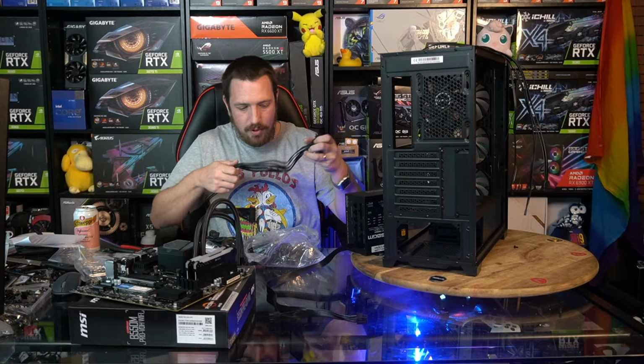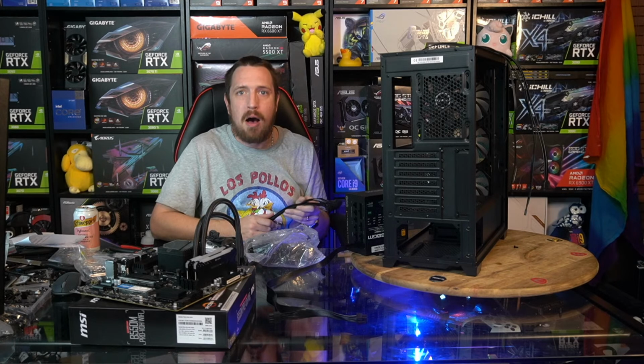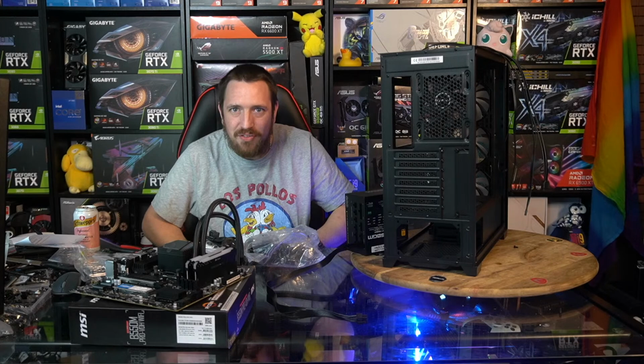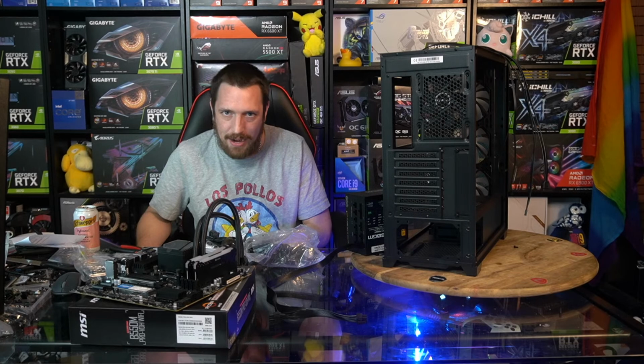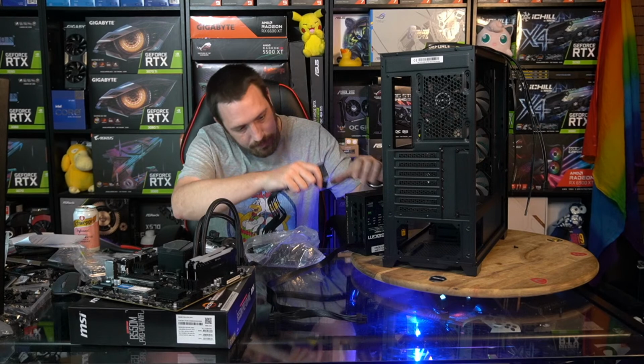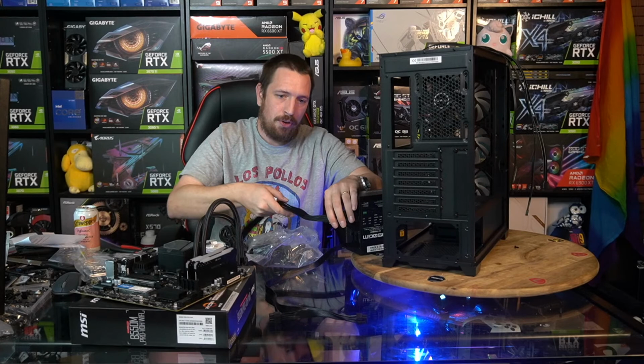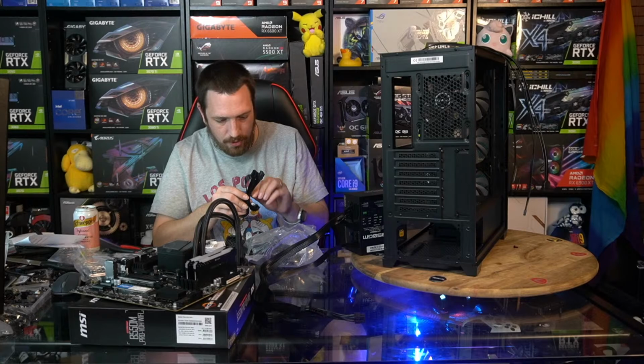Because fundamentally, what you're paying for with coolers and warranties, right? It's the pump, okay? The pump is the main moving part in it. The pump is what moves liquid through the whole thing. The fans, who cares? A fan dies, we just unbolt the fan and bolt in a new fan, nice and easy. If the pump dies, that's inside the unit. That's a pain in the ass. You can't fix that, basically, once that dies. So the main thing you pay for is the warranty on the pump. You want a good pump for your all-in-one liquid cooler. There's no point in having a crappier pump.